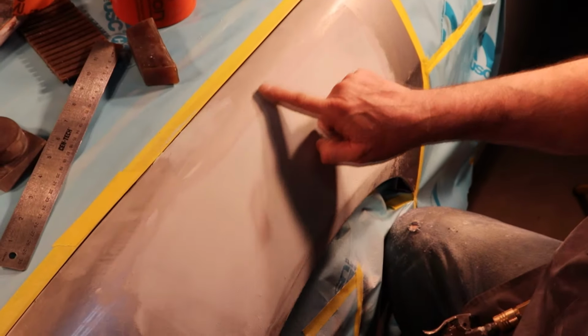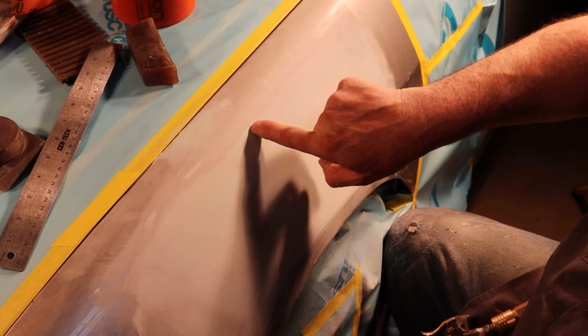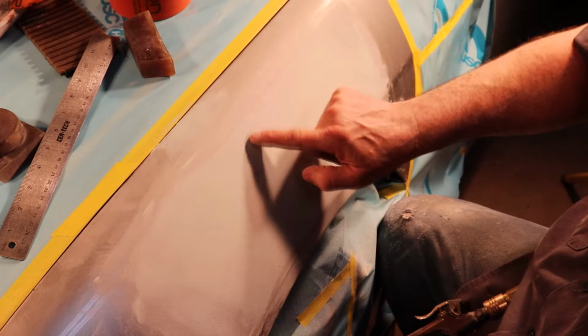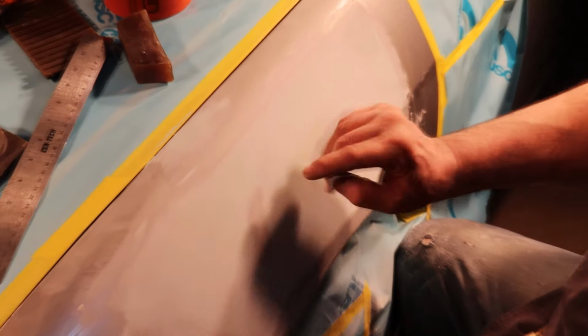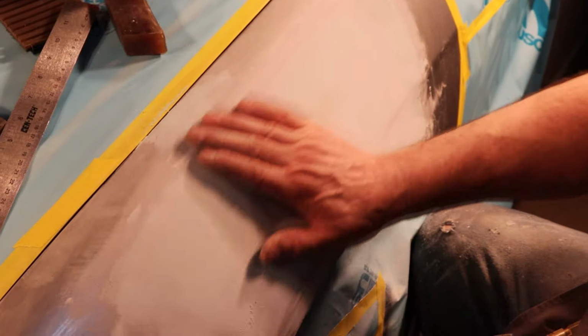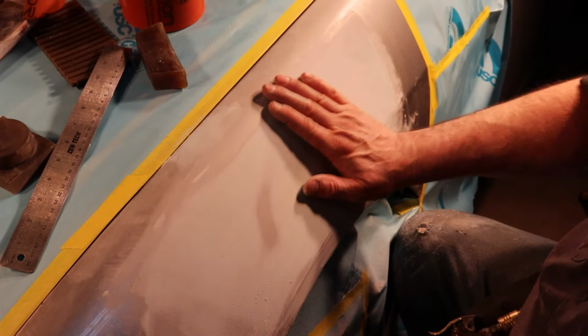With the old finish, you'll actually see the sanding marks will be straight through like that. You won't see any shiny paint, and you won't even be able to feel it. So you're going to use a lot less primer just to cover this up. You don't need to use the primer to restore the film thickness. You're just using the primer more or less like a sealer.